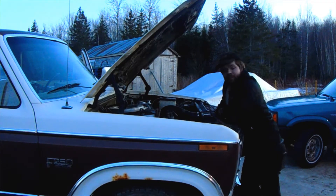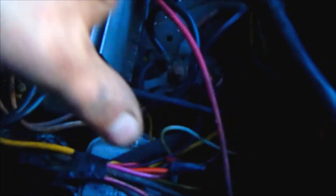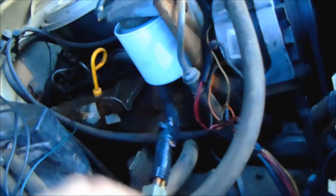What a lot of guys do is they completely bypass that unit. There's a little wire that you basically plug into — you run a toggle switch or push button. That wire is right here. I'm over on the passenger fender — this is the glow plug controller for the 6.9 IDI. Normally this little plug is in here, but I'll get to why it's not on there right now. This purple wire connects right here.